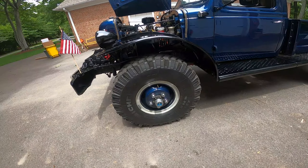Let's walk around to the other side. On this side, it looks pretty complicated — it's called a square top carburetor, and it is a fairly complicated carburetor. People took them and threw them out because they couldn't figure out how to make them run right. Fortunately there are a couple people around that can rebuild them. Demetri is his name — does a good job and it looks gorgeous. What some people don't notice is this mechanism here called a King Sealy Governor. It's not connected right now because I don't want it spinning when I'm not needing it, so I take the belt off when not in use. But the King Sealy Governor, with all this complicated linkage, governs the engine speed — it's like an engine speed governor for 1946.